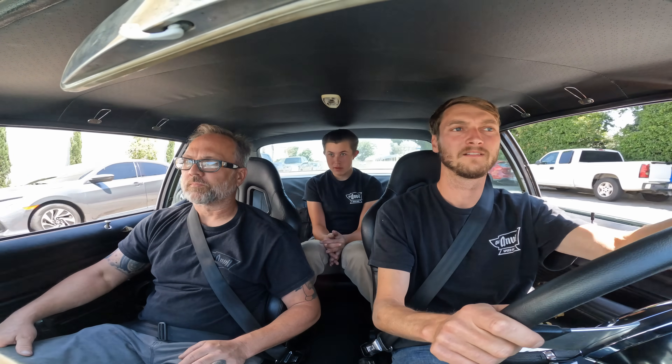That felt pretty good. It locked them up but it waited until we were about stopped. You want the rear to lock up just barely at the end of your stopping. If the fronts are locking up then you don't have enough rear. You can dial it back out. Front locking up is bad because then you lose your steering control. You want the back to lock up but not enough to spin you out, and not enough for the rear to come around. You want that front to nose dive and not lock up.